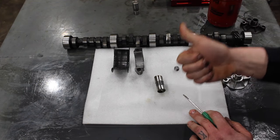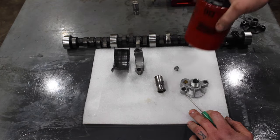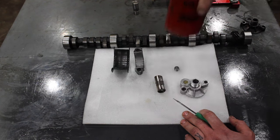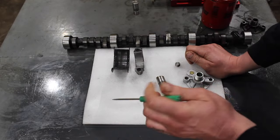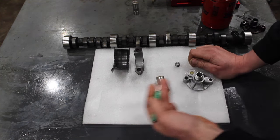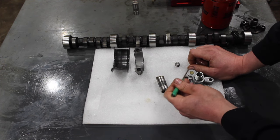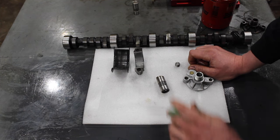I don't see a bulging filter, I don't see any drop in oil pressure, I don't see any ill effect with running a plugged bypass — but you have to run a good filter. If you run a cheap filter then you probably want a bypass just in case you start ballooning the filter case or something. I run Baldwin or Baldwin B6 on most of my small block Chevys. Baldwin filters are good, Wix filters are good. Even if you're running a roller cam I recommend running a plugged bypass, because even the crosshatch coming off the cylinder walls on a fresh motor produces some metal filings in the oil, and plugging the bypass ensures anything half-decently big gets caught in the oil filter rather than making its way directly into your bearings.